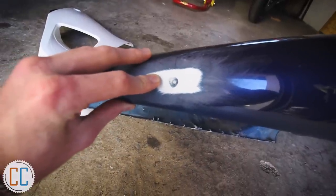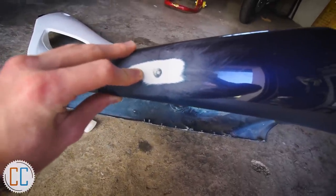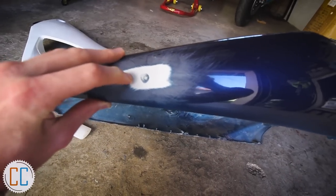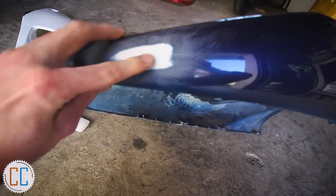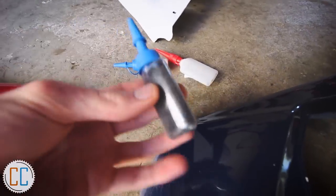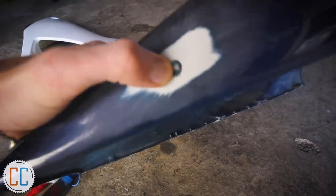Another thing I forgot to mention was how much work went into these fairings to get them ready to wrap. If you remember from the reveal video, there were indicators stuck to the side of the tail that I really didn't like, so we filled the hole that was drilled to run the cable through. We bought a body filling kit for motorcycle fairings — it's basically a powder you put in the crack or hole, then pour glue over it which sets the powder, and then you sand it down until it's smooth.